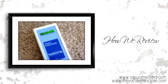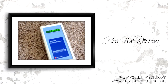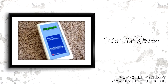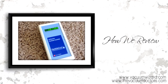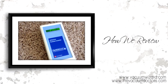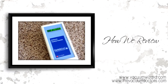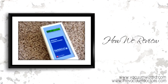The third and final meter is an airborne particle counter, used to measure particles coming out of the filtration system on the vacuum. This is one of the most important things we review, since a lot of people have health issues, breathing issues, asthma, and they need a good filtration machine. One important thing a lot of reviews miss: you first need to measure the particles already in the air of the room. Right now the particle meter is reading about 250,000, so if a vacuum comes back at about 250,000, it's only putting out the same amount of particles it took in — that's not very good filtration. But if the room started at 500,000 and the vacuum puts out 250,000, it's cut the particles in half, which is actually good even if it may not sound that way. So it's important the reviewer knows how to use this unit and does it properly.